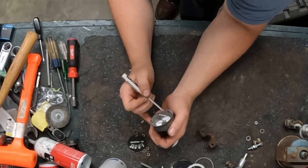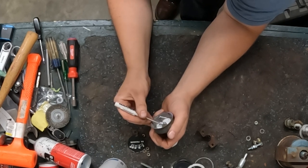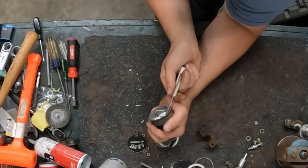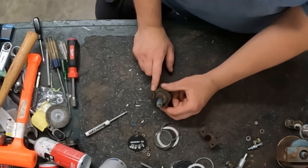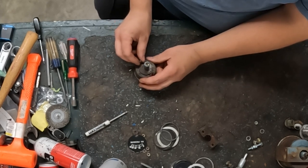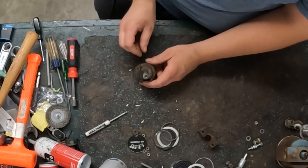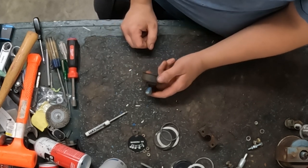This plate is what is riveted. And here in the center, when this gets pushed on by oil pressure, your needle will go up. That's for bending these studs back. These studs are welded to this case. So I'm basically going to have to heat this stud up and just kind of rock it back and forth to get it straight enough to where I can thread a nut onto it.